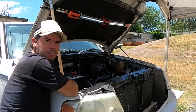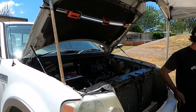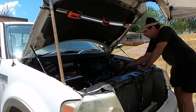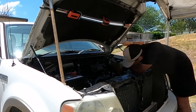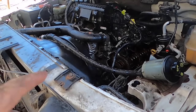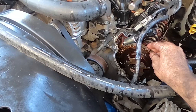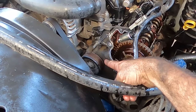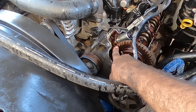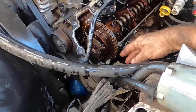It's just one cylinder down, no, it's a couple of cylinders still down. That chain doesn't seem loose, not loose enough to jump. It doesn't seem loose at all. That phaser's out again, it's moved again, so that means it's stuck again. So I'm standing back having a think, going, this doesn't seem right. It's got no play whatsoever in that chain. And then the more you think about it, the more you think the tensioner is on that side. So if the tension is working, these teeth are going to hold the tension onto it. But what about this side?